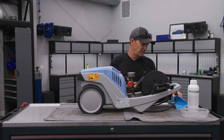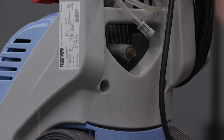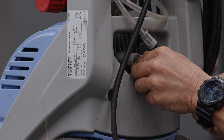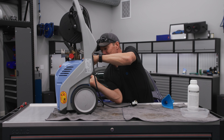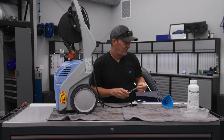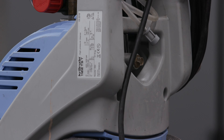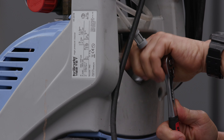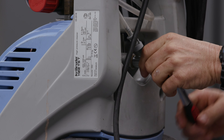First things first, I'm going to lean it up and loosen the drain plug down below — that's a 13-millimeter. I'll crack this loose. I'm going to have to get a ratchet and a socket for that. If yours isn't as old as mine and you've been servicing it regularly, your drain plug might not be as tight as mine was. I haven't ever cracked it loose, so there we go — that's got it loose.